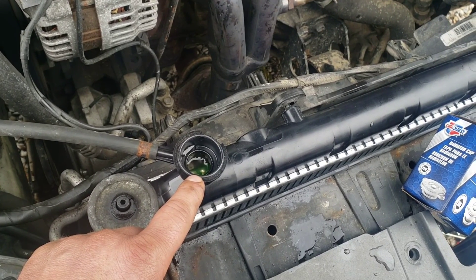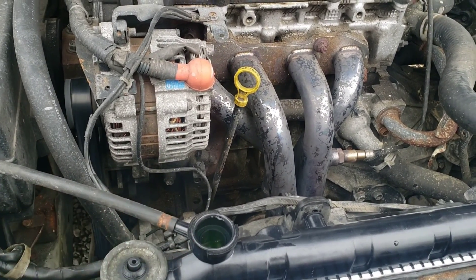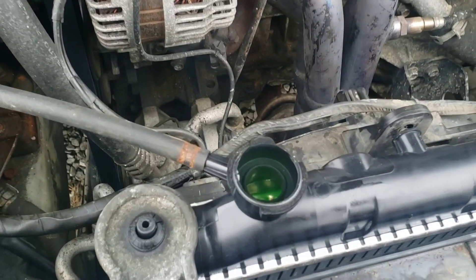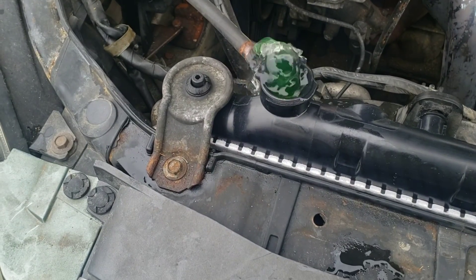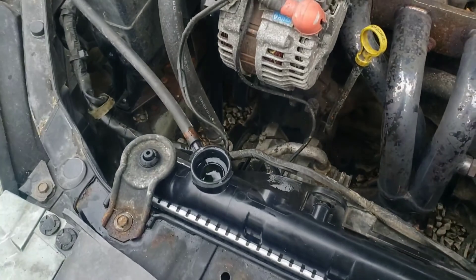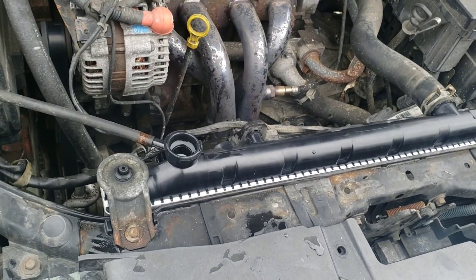It's starting to wiggle a little like it might want to take it. We're about two minutes in — I just saw the first few bubbles. You can see the level rising as it's trying to push the air bubbles out. It's probably going to overflow now like I said. I just squeeze that hose there — sometimes if you squeeze it and release it, that can help push some of the air out and suck the fluid back in. Sometimes it helps, sometimes it doesn't. Also, if you squeeze it too fast or too much, you might actually put more air in the system than what you're getting out.